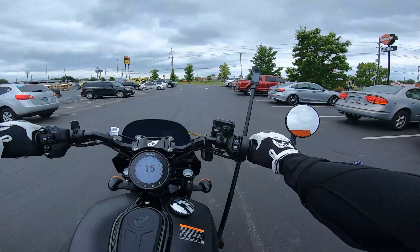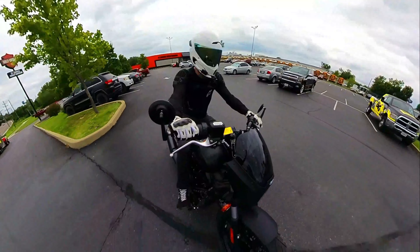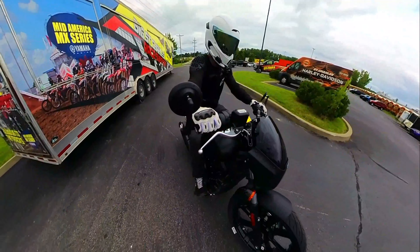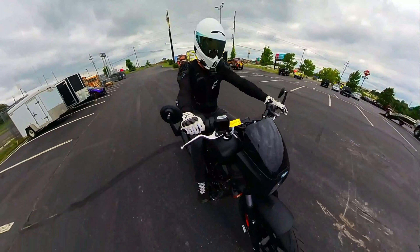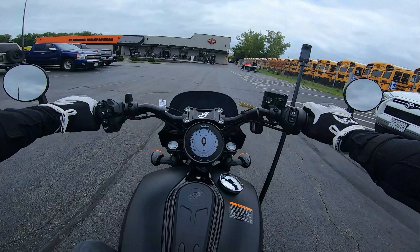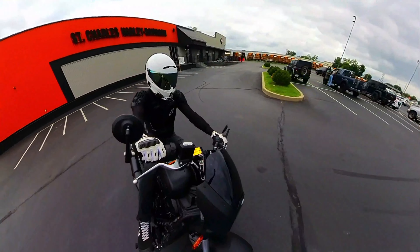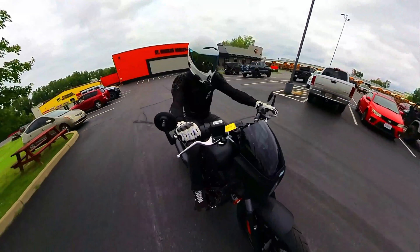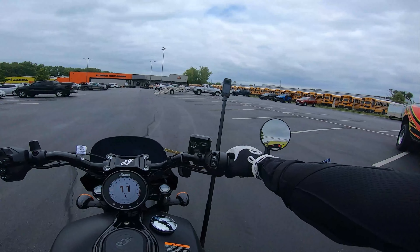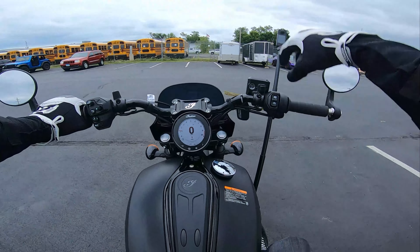Still very good stopping force on the front brake only. It's a pretty long wheelbase at 61 inches, so our handling and tipping-in is a little lazy — it's almost like you ask it to do it and then it does it a split second later. But the trade-off for that long wheelbase is stability at speed and great weight distribution. With 33 degrees of lean angle, we have about half the usable lean angle of a super sport, but this is a cruiser so we don't need a ton of lean angle.